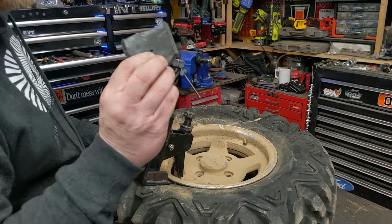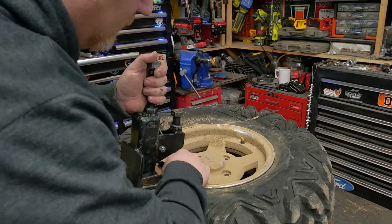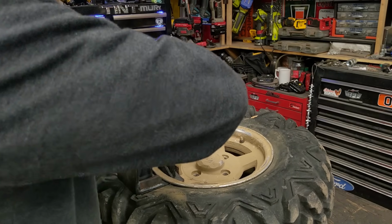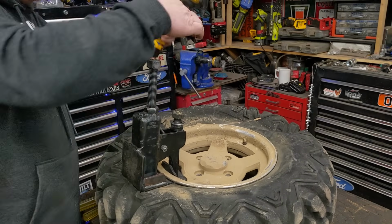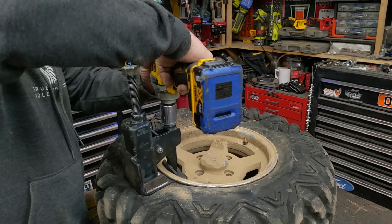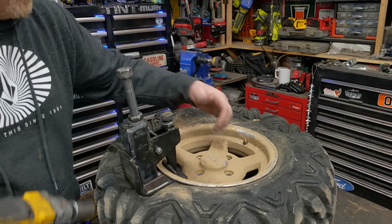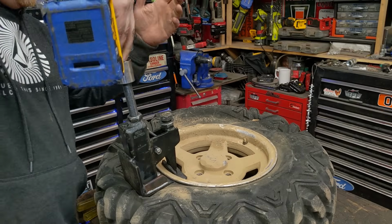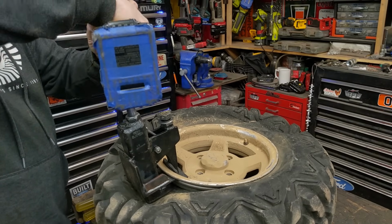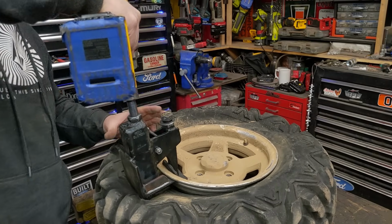There's this little thumb here. This is just a chunk of extra sidewall from another tire. I'm going to put that right under there. This pulls itself in against the tire. Pulls this under it. So this is the easy side because I only have a little bit of a lip before the well. So the front side's the easy side on an ATV tire. Completely broken.